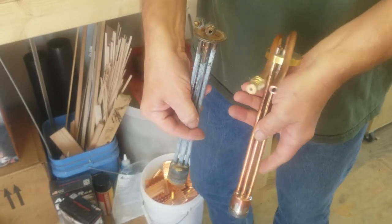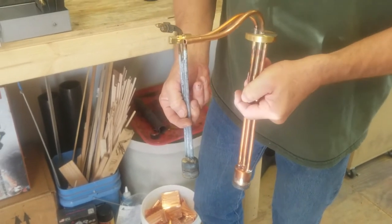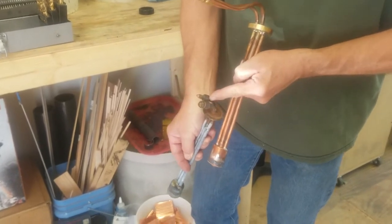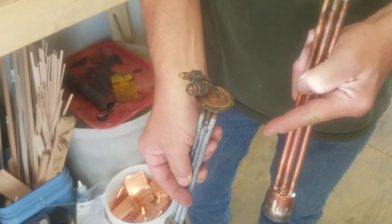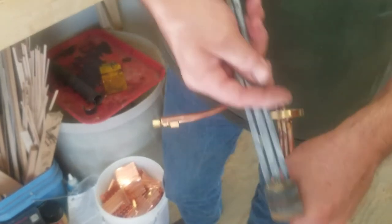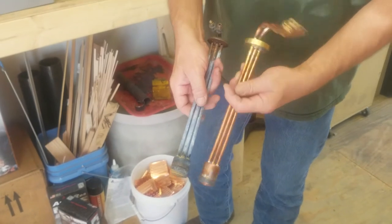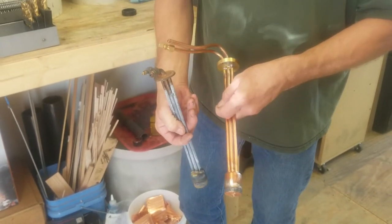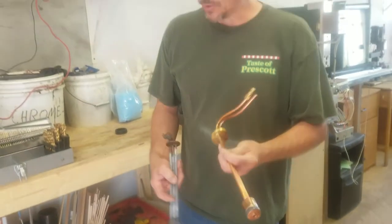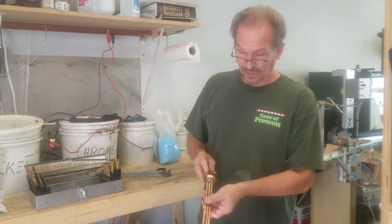You can see when you look at the two of them — this one is all brass, copper, and JB Weld, made to be very permanent. The original over here has really short pieces which, as I said, are hard and not very serviceable, so I've switched to longer ones. None of this will actually show on the car, but it's totally vital that it operates. I would say we've made a bit of an improvement in constructing our new one. And that's how, in general, you do a King Seeley early system fuel pickup and gauge pickup.